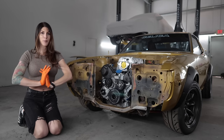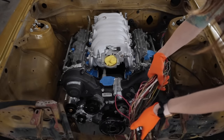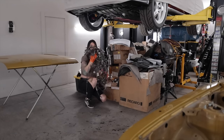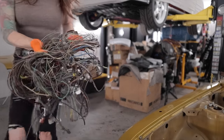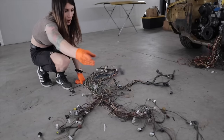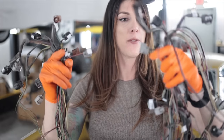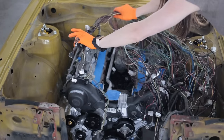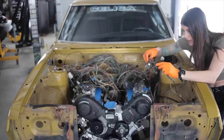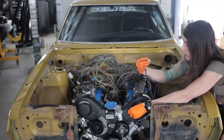What commences next is my personal favorite part of a project. The best way to do this is to take the Celica's wiring right here, which is pretty much just for the gauges — there's not a lot of wires here. This right here is the harness from a 2005 Sequoia — it's a big mess. These all go to the ECU. There are absolutely two ways I could have done this: one, do a standalone wiring harness like I did in the MR2 from scratch, or two, use the Toyota engine harness from the factory and modify it to work.